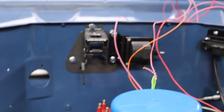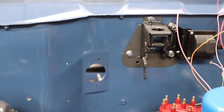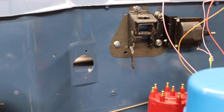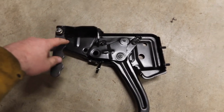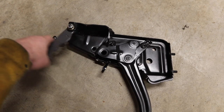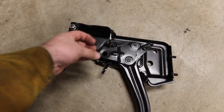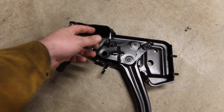That's the passenger fender. The hood release I had modified — I added a section at the bottom where my custom hood release latch comes through. This is a stock Scout parking brake assembly and I added on a piece and a holder so that I can take my old Lokar transmission kickdown lever and go like this to open the hood. If you ever need to make a custom hood opener, you just need a point to fix the cable in and a point of leverage. Normally it's a knob on the dash, and everyone just ends up using vice grips to open their hoods on the Scouts.